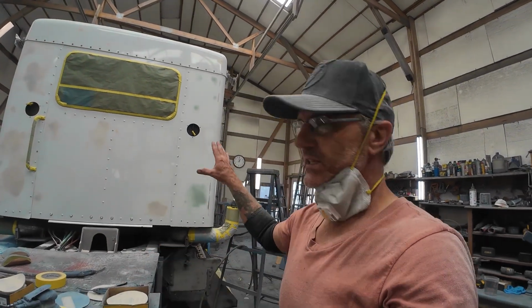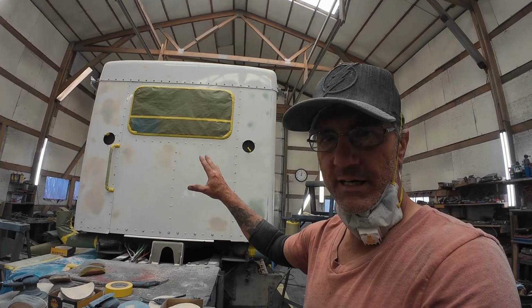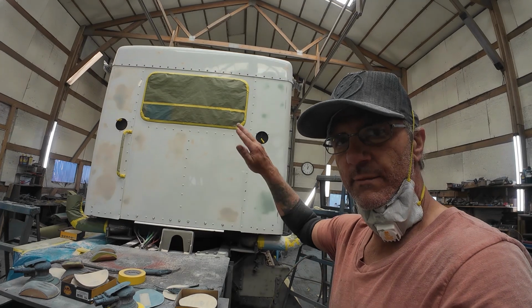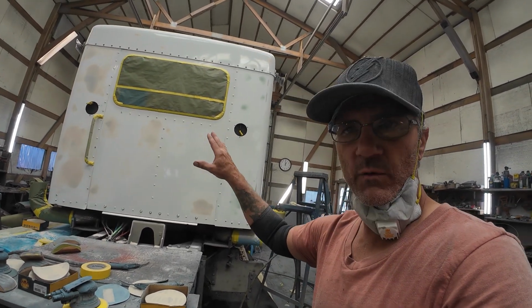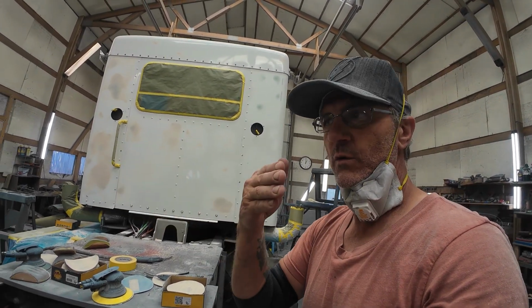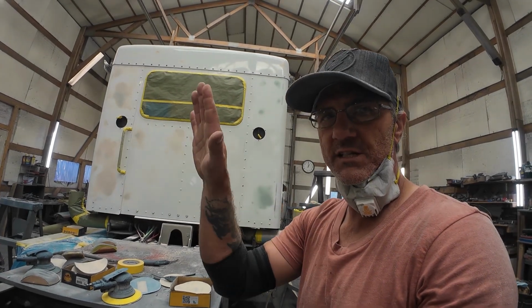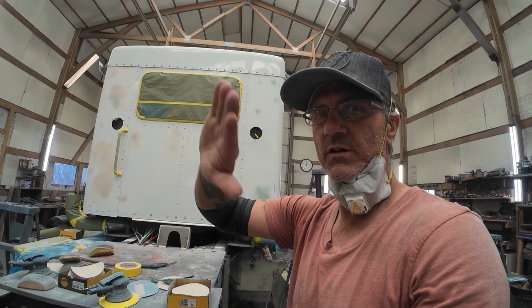Glazing comes out of the tube, usually white or off-white. Same with bodywork, it's anywhere from gray to gold. But once you mix the hardeners with it, that's where you get your color. And so a lot of times, especially if I'm going to film it, I'll do my bodywork in one color and then my glazing in another color so you can see the difference. And that's why there's different colors of hardener, so you can see the difference between layers of bodywork. If you end up having a dent that's so deep you go over it 2 or 3 times and you do it in a different color every time, then you can see exactly where you've sanded to. It's easier to see where the old stuff is and where the new stuff is.